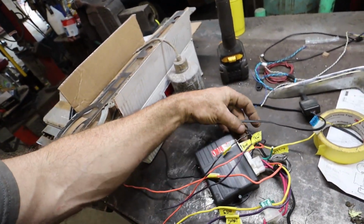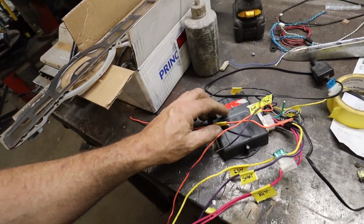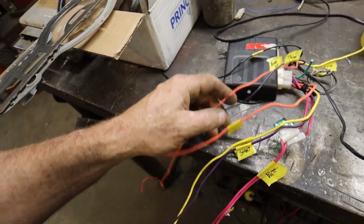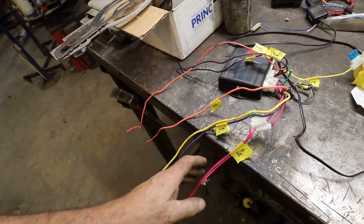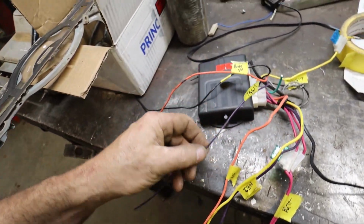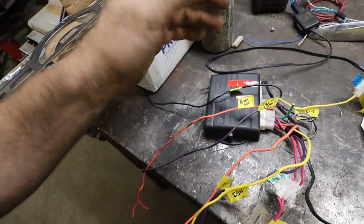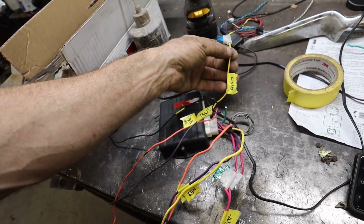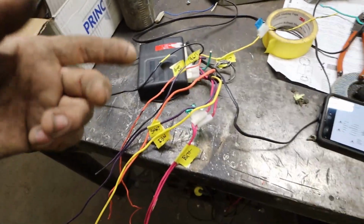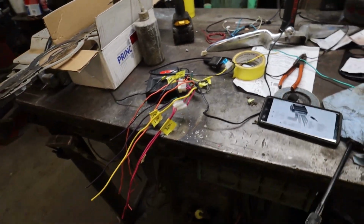While I'm still working on a little bit of electrical here, I'm going to hook up my command start, remote start, different options. Anyways, a kid was scrapping a car, had one in it, so I pulled it out and labeled it up. So it should be pretty straightforward. They're not that complicated really. You have your battery, your start, goes to ignition, goes to accessories, accessories being your heater, whatever else. And then over here you got tach, your brake switch. You need the tach so it'll know it started, so it'll stop cranking. And then this goes to the brake switch in case somebody takes off with it, turns off. That is a ground. And then this one just goes to light so you know it's running. So that's pretty much the real low down basics of it. Because it has no security system in there, I don't need any of that stuff, like this bypass and all this stuff that was in it. So anyways, I'm going to stick this in there quick and see if it works.